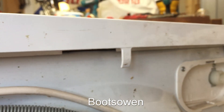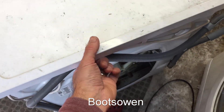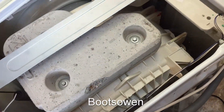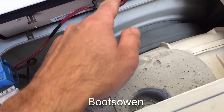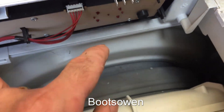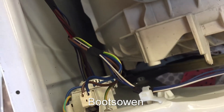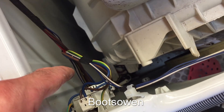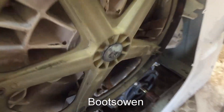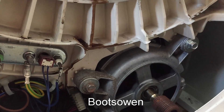Normally there's a date code on some of the plastics inside, so I'll get the top off and return. Two screws to get the top off, pull it back, lift it up and we're in. I can tell straight away the control panel is not here - this is an interface board with a five-wire connection down to a control board below. I think it's a brushed motor - can't tell from there, I need to see the other side. The number of wires suggests it's a universal motor.